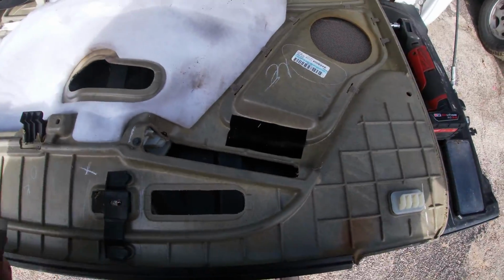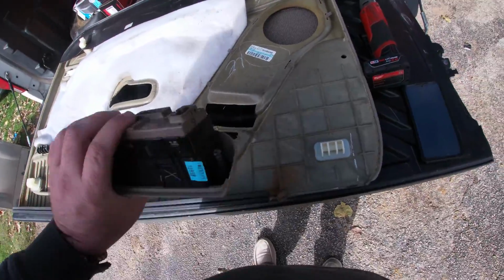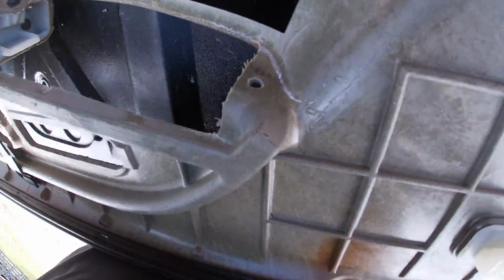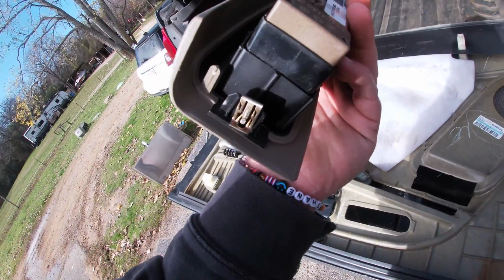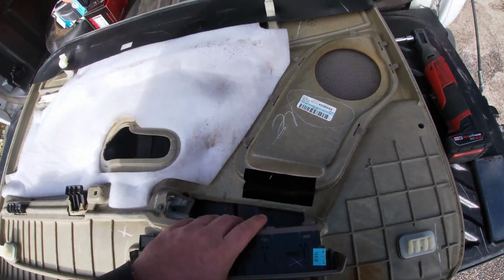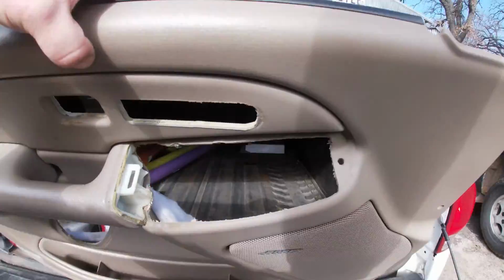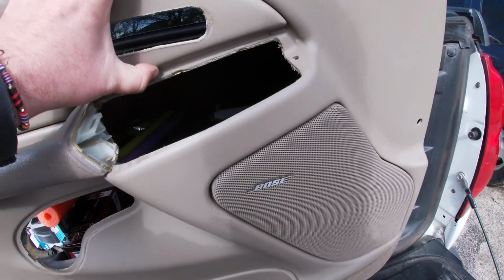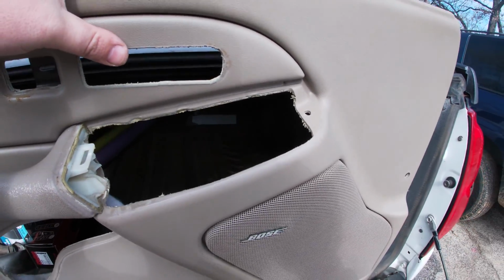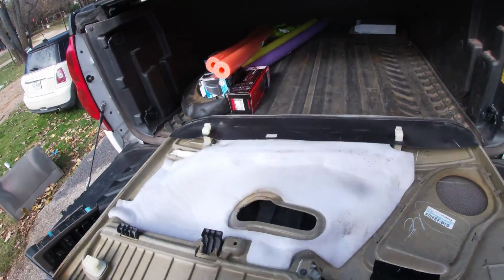All right, once you get the door panel off, if you look at the switch here, I have it out in my hand. So when it's in position, you have a 7mm screw. It goes right through here for 9/32, and then a push pin on the bottom. So you take that screw out, and then you just kind of smack it from the bottom side. It will release. I also pulled my heated seat controls because I feel like they may be in the way of manipulating this panel. It's a super tight squeeze in and out of here. So you just kind of got to work it out. But once you get it out, you're on the home stretch.